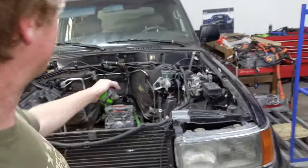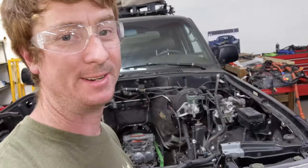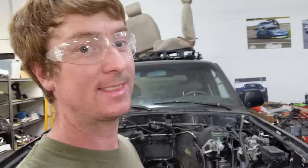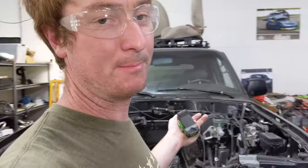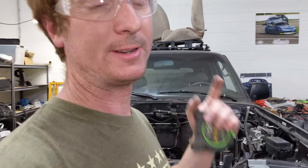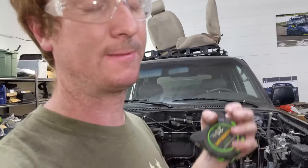Now that the piece is chopped off, the motor fits so nicely in there. I'm still a little worried because the driveshaft is going to be so short — I'm not sure if it's possible to make a driveshaft that short that functions at 10,000 RPM. I can't do a rigid solid driveshaft because I'd need to machine some sort of intermediary adapter plate between the motor and the transfer case. That would be a lot of work and requires very tight tolerances — four thousandths of an inch — so that shaft when spinning isn't off-center, because any wobble will tear apart the bearings and possibly cause more damage to the motor.